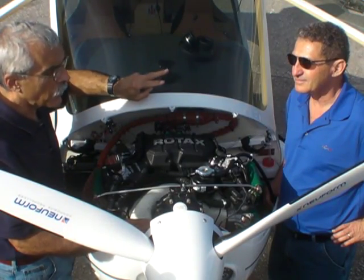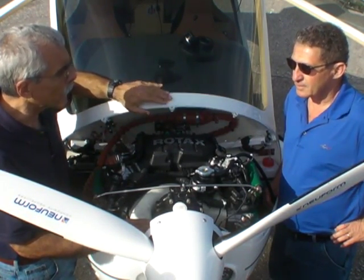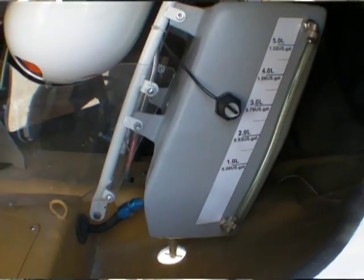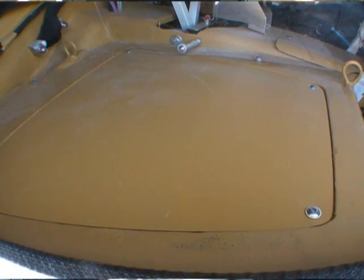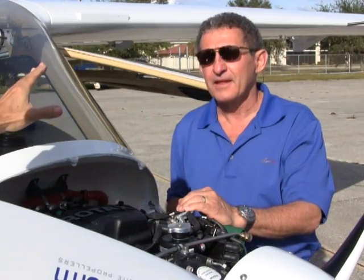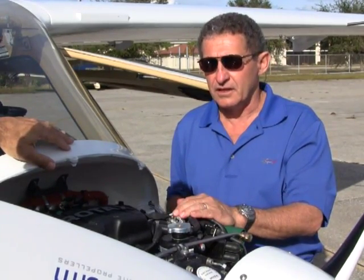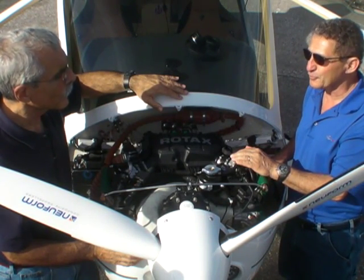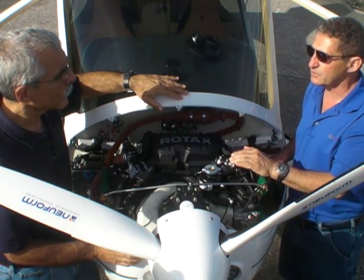In order to make that work, it has a couple of high-pressure fuel pumps. Some installations we've seen have them on the firewall, but here they're in the back. We have two fuel pumps mounted in the rear baggage compartment underneath the floor, and the fuel feeds from the two wings straight down towards the header tank, then through the two fuel pumps into the engine. There is no header tank on the other Rotax-installed engines, but there is on this fuel-injected version. The header tank gives you a warning when you're running out of fuel — at about 1.7 gallons, an annunciator light comes on and you have 10 to 15 minutes to find a place to land.